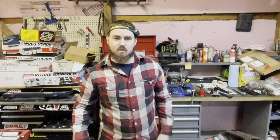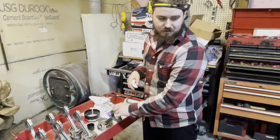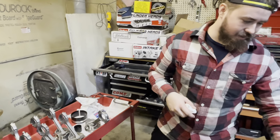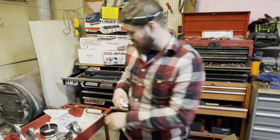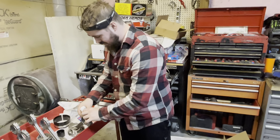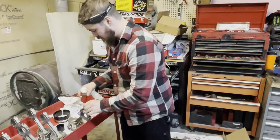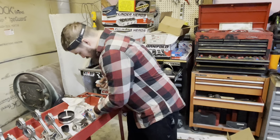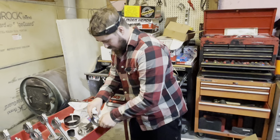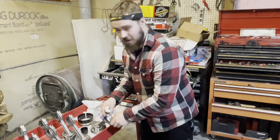Let's start plugging holes with pistons. We already did one, but let's do one together. This is the number two piston right here from the machine shop where the guy marked them. I'm hoping he marked it so number two piston goes in number two cylinder. Well, let's go ahead and take this cap off, get it cleaned out, get some assembly lube on it. Get it pushed down in there — I haven't taken that one down that I already put in there, we'll put them down together.